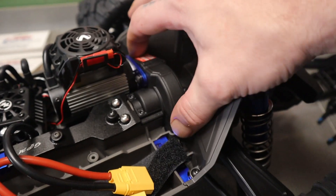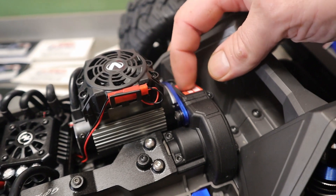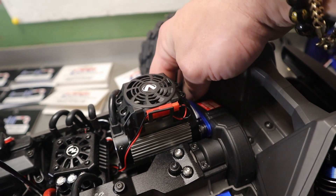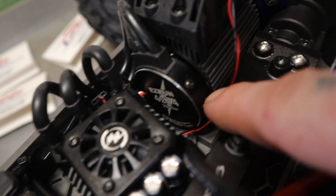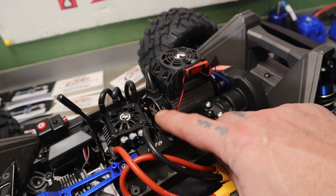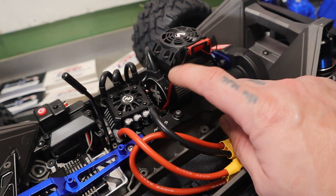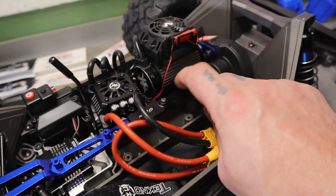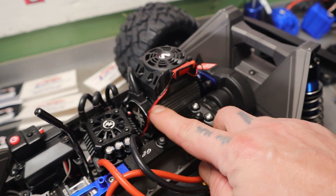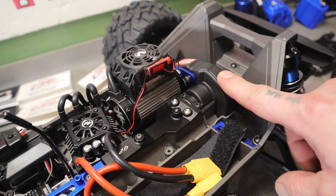Being aluminum, it would mount to this much better. I'm not crazy about how this motor mounts — it has four screws going into this aluminum plate, but this aluminum plate's only held on by a screw here to this plastic piece, and then another one underneath that goes into the bottom of the plastic. There's a little cup thing that the actual motor sits on. In the manual, Traxxas does have a part number for what appears to be a larger motor mount, but I don't know if they're just not making it yet. GPM does make that all-aluminum version, but I'm not sure because with the bigger motor, I'm not sure I want to squeeze it into an aluminum one where it won't have any give. Changing out the bulkhead might not be a bad idea.